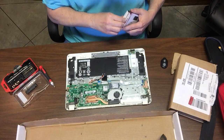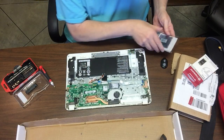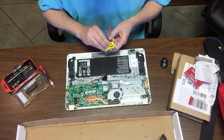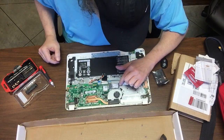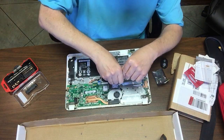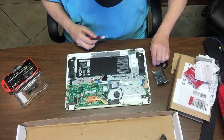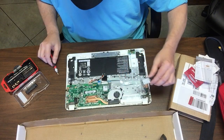So what we're going to do is take this 16GB drive out and hopefully the new one is the same size — that I ordered the right one. If not, this next few seconds could be awkward. Yep, same size. It is humid enough in here that I'm not worried about static electricity — that's one of the best parts of living in the South. I've never done this before, but it looks like that's a Phillips head. I'm going to make sure I find the perfect fit. It's coming right up — I take it all the way out, there we go. I'm going to gently slide that out and set it over here.